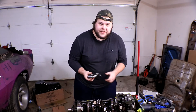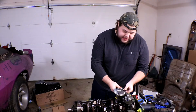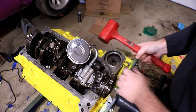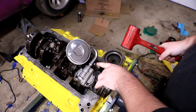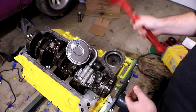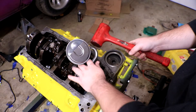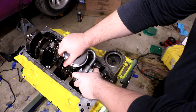Now you may be thinking we're missing a piece on there, and you're absolutely right — we still have to put the oil pump pickup on here. That just slides into the hole on this side. It's a very snug fit, so just lightly get it snugged in there. Then I like to take just a rubber mallet and lightly tap this in. It might take a few tries and a while to get this in, so just be very gentle as you're tapping it. You don't want to bend this, you don't want to break it — be fairly careful. This will slowly slide in there. It's in about as far as it can go and it's still a little bit loose here, which is exactly what we want. We want to leave it loose because the next part uses the oil pan to push that down into the right place so we get the right height on that oil pickup.